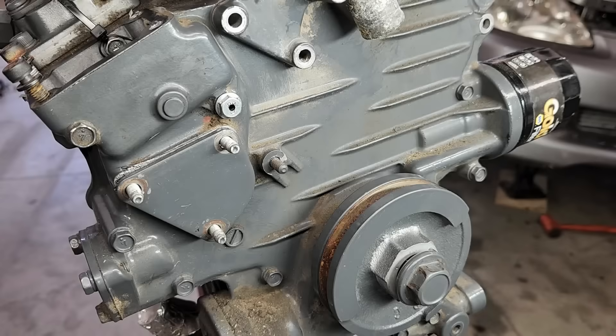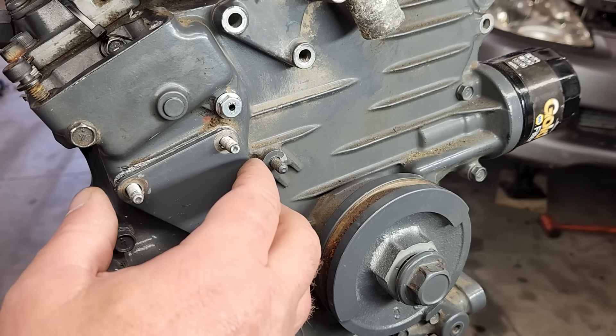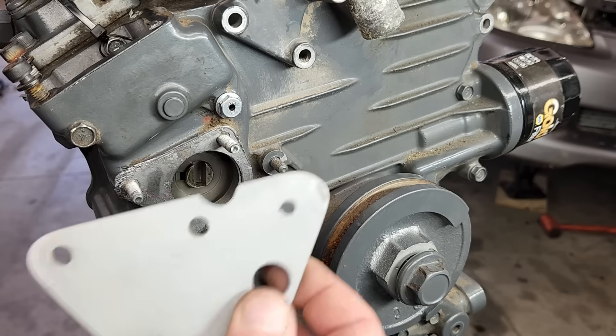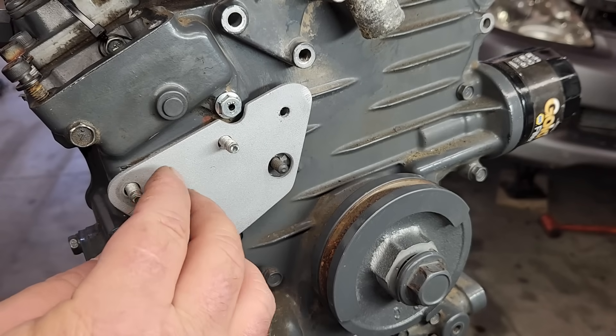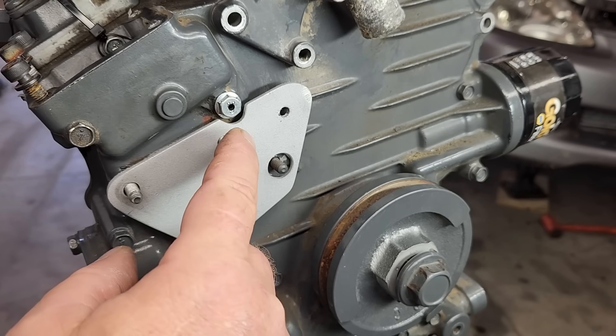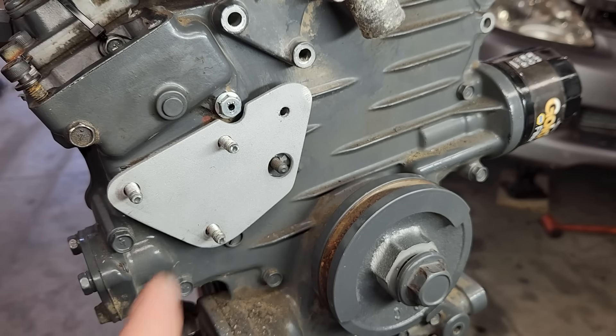Let's take a look at our spare engine, and I'll show you how the redesigned part fits. This bolt with a 3mm hole drilled in its center takes the place of the original fuel rack limiter screw. For the redesigned gizmo, we need to get rid of this cover and replace it with a custom made cover. This new cover does two things: first, it's one millimeter thinner — and trust me, we need all the space we can get — plus it provides a wider mounting base.